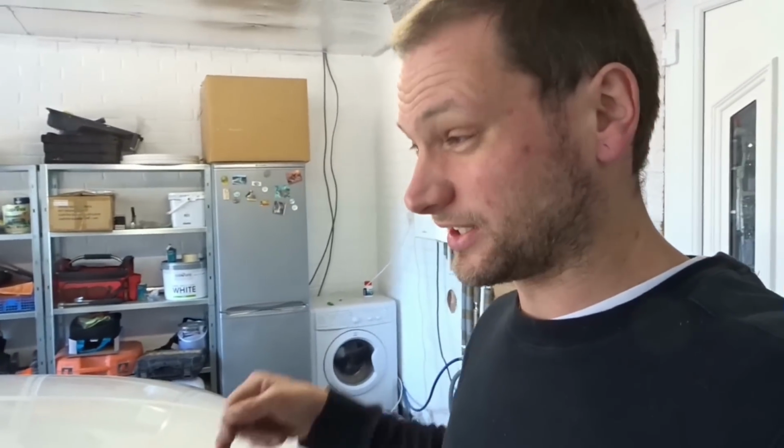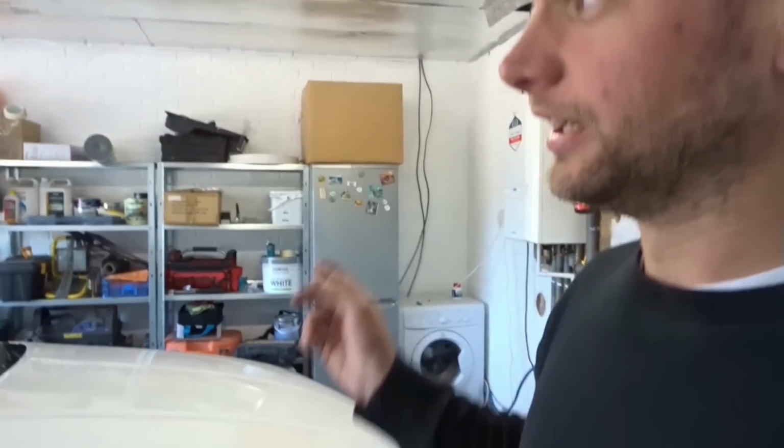So after another road test with the rear arches rolled and all the camber on the front, it's still scrubbed a little bit on the front. So I've gone and bought more new tyres for the front, and I went to a place that had a bead blaster, so they've properly stretched it on. And while the wheel's off, I'm going to roll this front arch a little bit. So I'll take these screws out, the arch liner screws, roll the arch, and hopefully I won't have any more scrubbing issues at all. And then I just need to get it all aligned, and then that's it. Ready for the road.